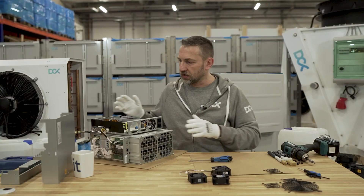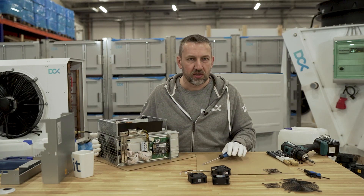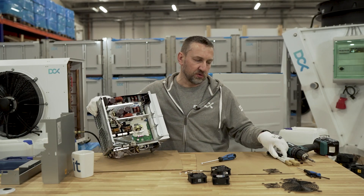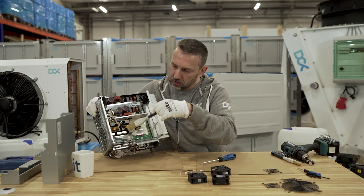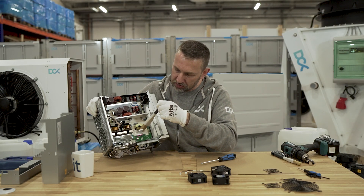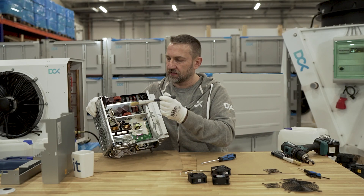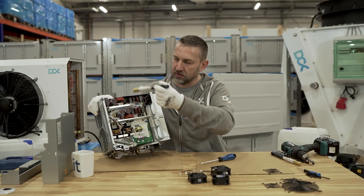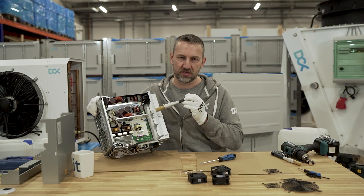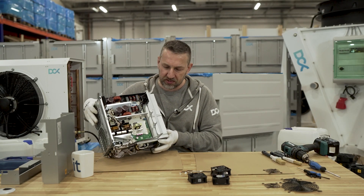All the fans are removed now. As I said, if there's lots of dust, start by brushing everything and using compressed air - at every detail, every component you may find. Then clean it carefully and after that you'll be able to flush it with isopropyl alcohol, running the alcohol through and cleaning everything. The most important part is using compressed air first to remove all the dirt.